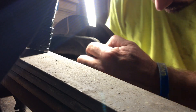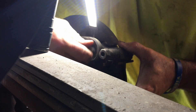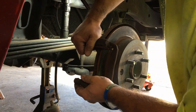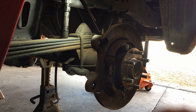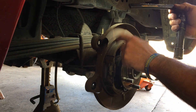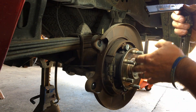See these bolts right back here — there's one on top, one on bottom. They're 19 millimeter. Break them loose. There's the one on top, screws right out. One on bottom broke loose, screws right out, slides right off just like that. In this piece here is your emergency brake — these are your emergency brake pads. They have absolutely hardly any wear on them. They're only used when you stop and keep the truck from rolling.